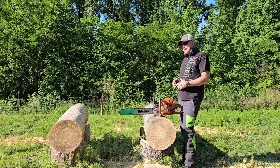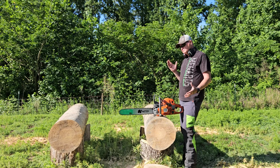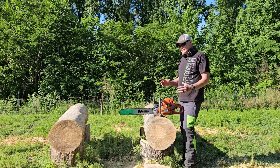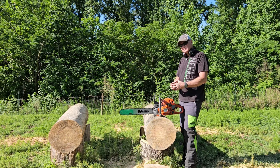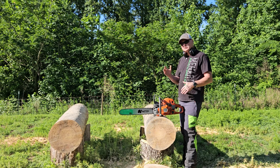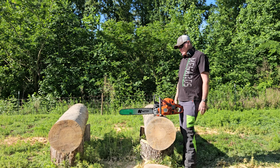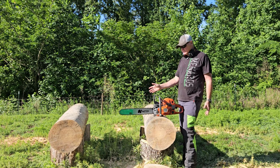My guess is that is a clear attribute to these things not having a stuffed crank. The Mark I has stuffers, and so that's a closer, tighter crankcase because of those stuffers, and that gives you great throttle response and it'll get up to the higher RPMs quicker. But generally speaking, whenever you have an open crankcase, they're more apt to have a broader power band. And I think I could feel that right there. That felt really good. I like it. But I mean, it's too early to tell anything.